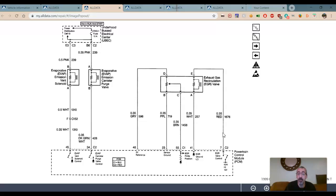If we can open that up fully and that engine almost stalls, boom, we just proved our EGR passages are clear. If we open it all the way and the engine does not stall, then we can presume that those passageways are plugged with carbon, and that's our problem, and we can clean them all out. All done with the computer.